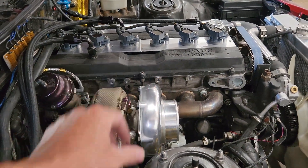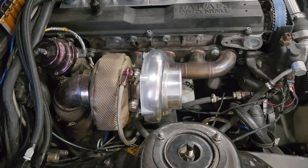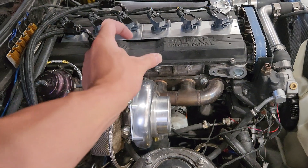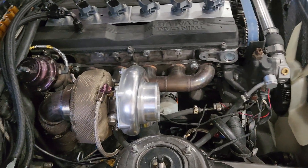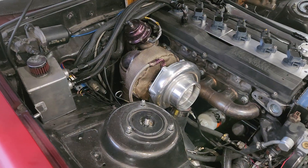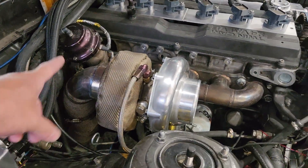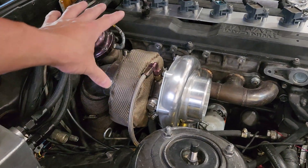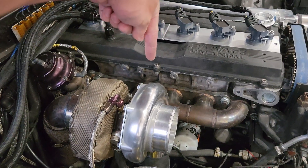It's not ideal seeing how far back the turbo sits, but if you want to leave everything the same, this setup has worked great. I've actually run a bigger turbo with this setup and was able to clear around the throttle body using a 45-degree rubber coupler and run the intercooler piping down through there with no issues — it was tight but it fit. If you're copying this setup, keep in mind that if you're running a non-internally-wastegated turbo you're going to need an external wastegate, so think about whether you put it here or next to the turbo if you've gone to the forward-facing intake manifold.